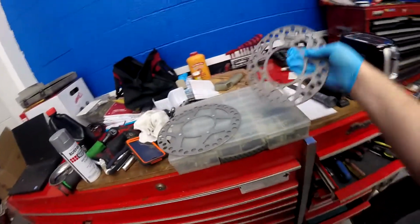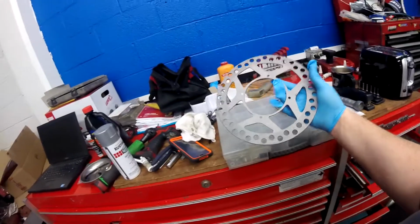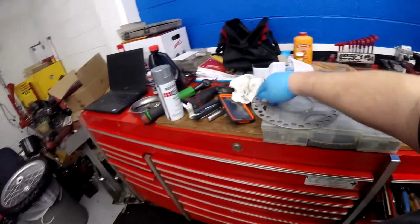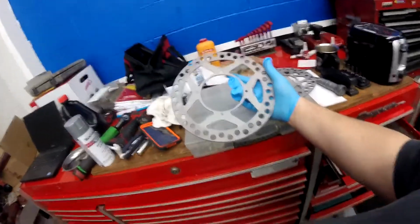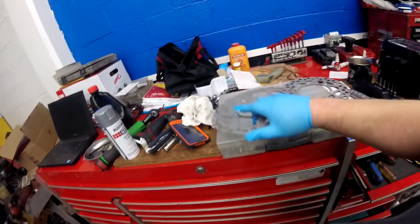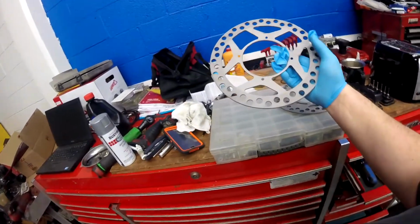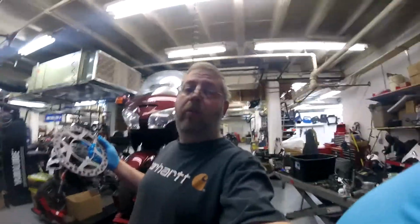So we're going to build the bike, use the old pads, ride over freshly painted rotors, let the old pads scrape a perfect circle around the wear mark, and what we'll be left with are rotors that are painted nicely everywhere else, all inside the holes, all inside the crevices, and around the part that mounts to the rotor. Because they are steel, we're going to be washing the bike, riding in the mud, we don't want rust.